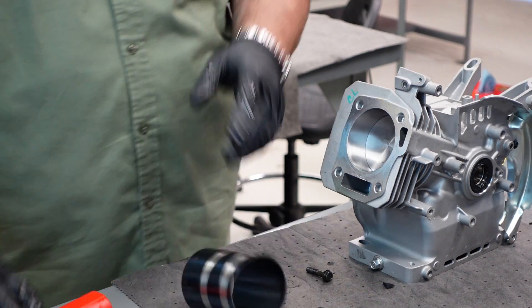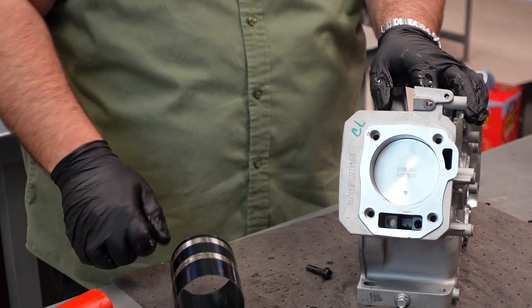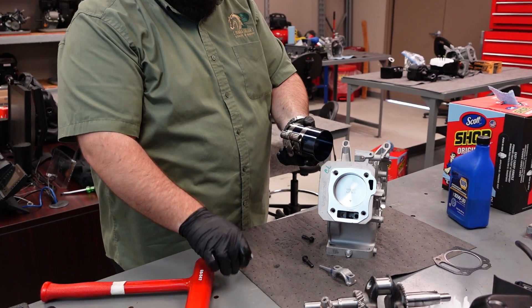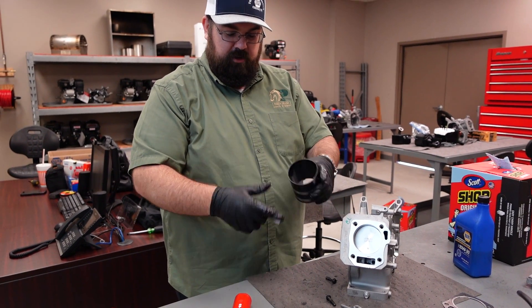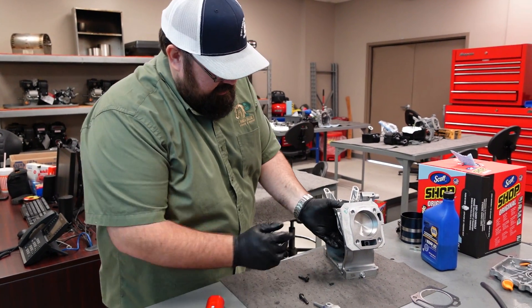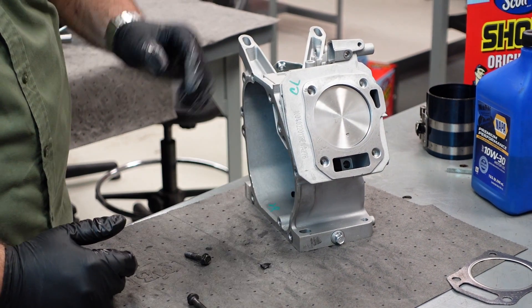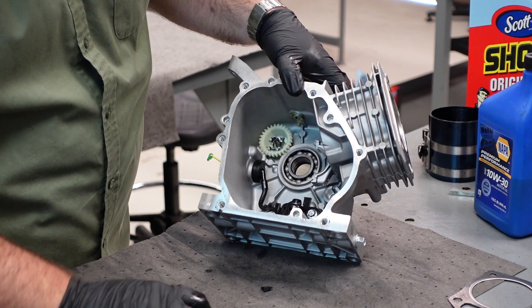There it went. So once you have a good smooth strike and the rings didn't expand on you, the faster the better. That's why it's actually best to use the long nose of the handle and swing at it. But I always have students that end up striking the tool — it's just a hard target to hit because it's so small. Once you get up to a bigger piston, like an automotive-sized piston, no big deal. Now what you want to do is push that piston back out, but don't come all the way out — push up to about an eighth to a quarter inch below deck. That gives me enough room to work inside.